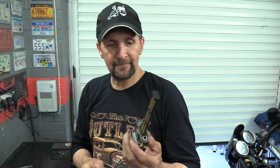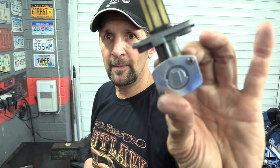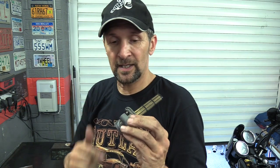Right, fuel tap. Now this little fuel tap, I'm reliably informed that the method of manufacture at the factory is that they are simply pressed in. They're just an interference fit and that seals. That's it. There's no jollop in there of any kind. There's no grease in there. They have to go in dry. There's no sealant of any kind.